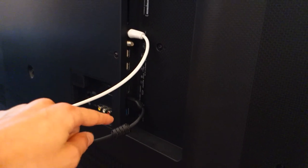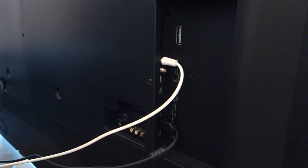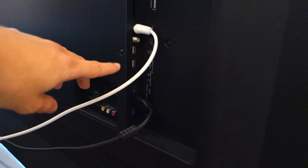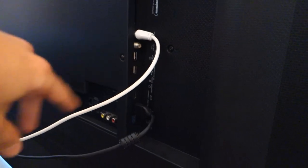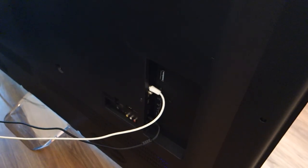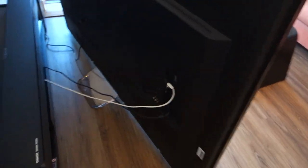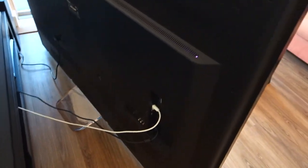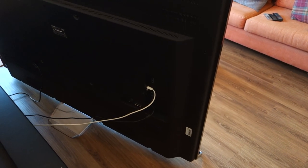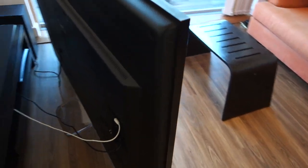There are three USB ports, but I'm not sure why only one is USB 3.0 and the other two are 2.0 — it would have made a lot more sense if all three were 3.0. You've also got your standard antenna and cable connection, a headphone output, and a service jack. In terms of inputs and outputs, I'm in two minds. I like having a nice selection built in rather than a separate box like Samsung's One Connect, but I would have liked more modern connections. Why are we using HDMI 1.4 on a £3,500 TV? I honestly have no idea.